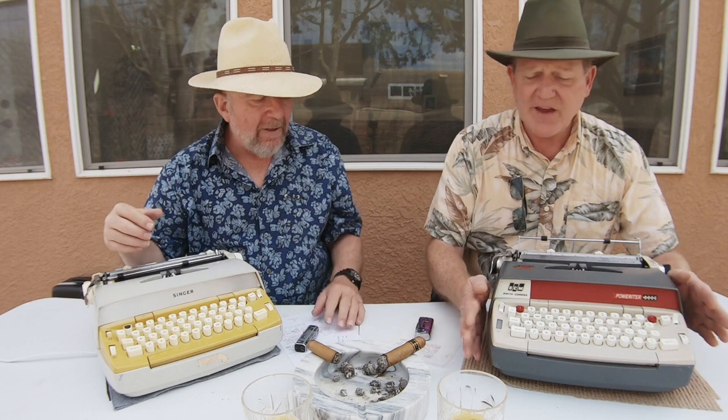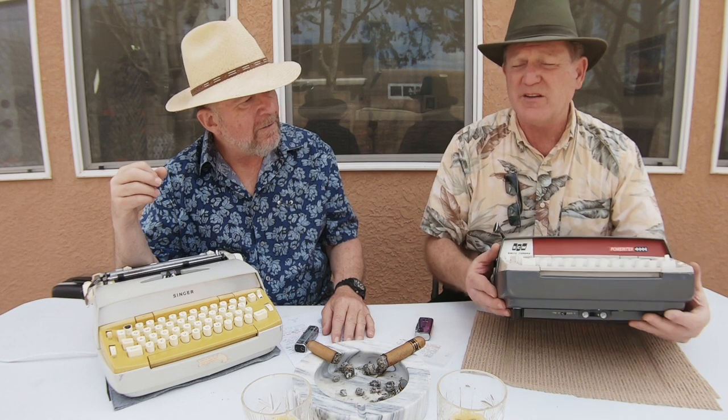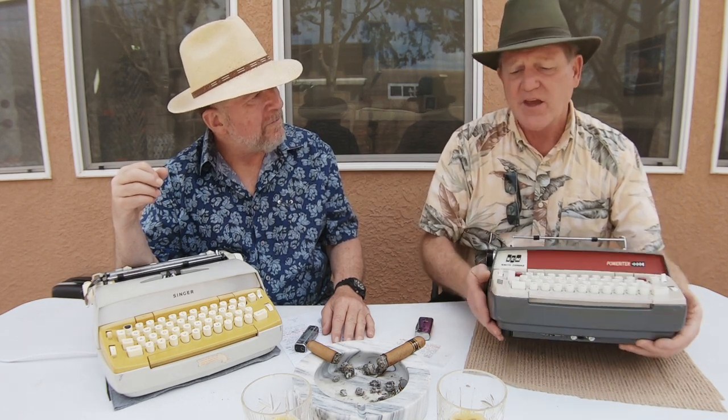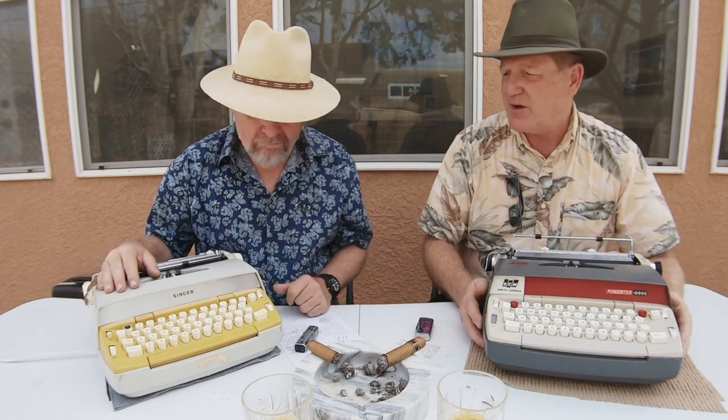It's charging the battery. And you need to know that because since this is a NiCad battery, you can't leave it like a modern lithium battery setup with a power regulation. You can't leave it plugged in all the time. You have to unplug it so that you don't overcharge the battery. And you can tell if you're overcharging the battery because underneath here where the power pack is, it will get hot. Okay. I mean, it'll get warm, right. So it's time to unplug the power supply.